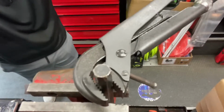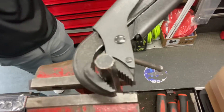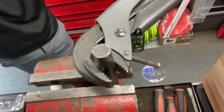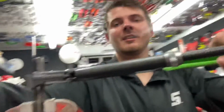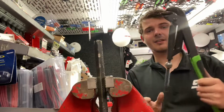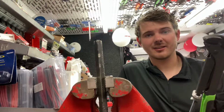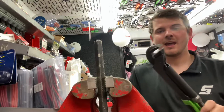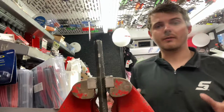But basically, you'll see that those jaws articulate around that steel stock and do not let go. Now there's basically nothing gonna allow that bolt to release out of the jaws of this bad boy. So great little product. I will tell you, mainly we've sold them to plumbers, anything with rounded fasteners. So of course, plumbing, tie rod ends for alignments, or just in general rounded bolts. They're a great extraction tool if you have the room for them.